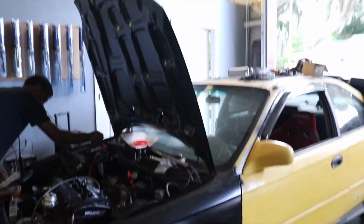So we get fuel pump priming, because we do have the 50 PSI necessary to start the car. It's actually got 62, which is plenty. We have oil pressure, we have fuel pressure, we have oil in it. And at this point, it's kind of just got to happen or it don't. I don't know. My mental instability showing.